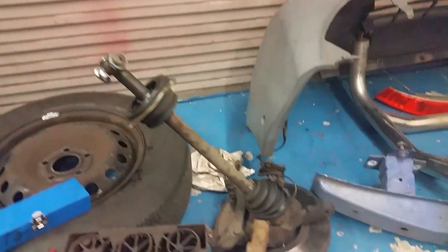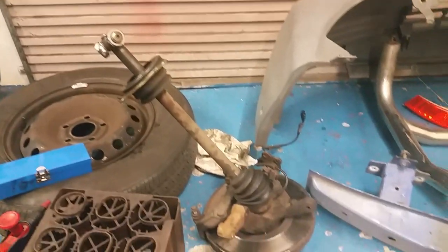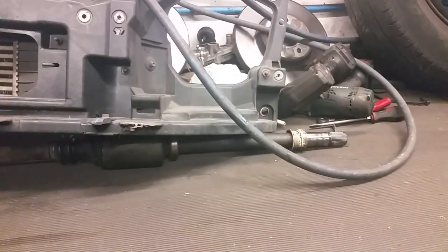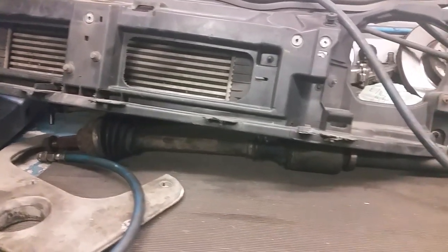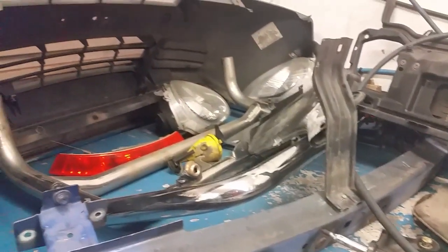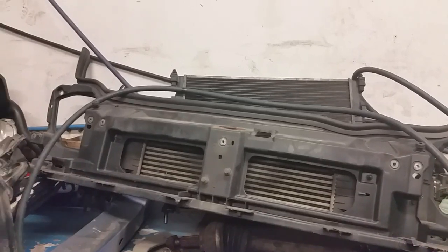The concentric slave is not that expensive — about 50 quid — but there's a fair bit of work pulling the driveshafts. This shaft here actually wouldn't come out of the hub, so we just unscrewed it out of the gearbox — hub, shaft and all. The other shaft is hiding under there, that comes out of the center bearing and into the end of the gearbox. That's the driver's side UK shaft — the long shaft that goes into the gearbox. Most of the stuff lying on the floor here is actually the front end.